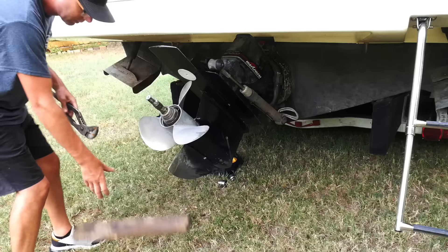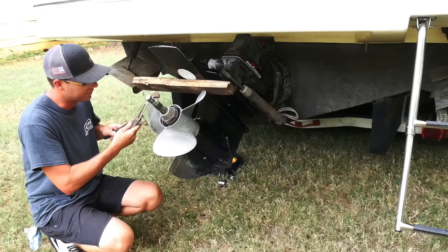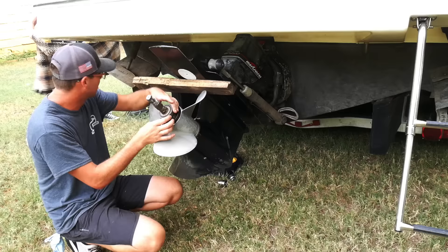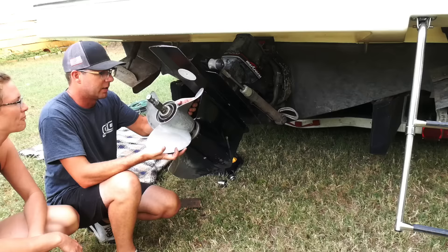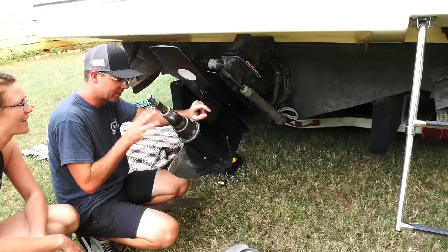A good way to lock this prop up is to put a board in between here. This torques to 100 foot-pounds and there's almost no chance I'll get it off. But — oh, that was loose. That's strange, that was really loose. Hopefully there's not something broken inside that caused it to loosen up. The inside nut just came right off. Everything I've read shows it's required to lock down to 100 foot-pounds and that was about 2 foot-pounds. So I was saying hopefully there's not something that's given way in here. Anybody need some 28-pitch props? There they are — we have some. We'll clean all this up, get some new grease on it, pull those other props off, roll the 24s on, and hopefully get them tighter than they were before.